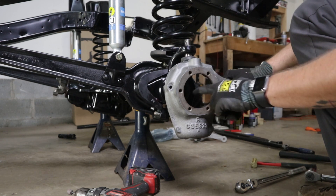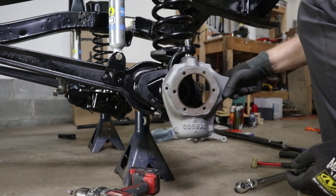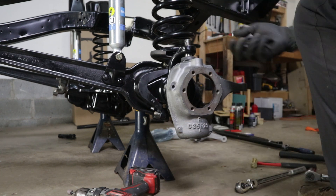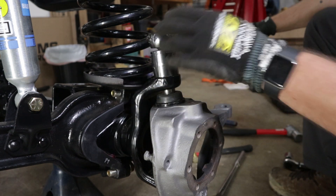We've got 90 foot-pounds down on our bottom nut, and 25 to 28 foot-pounds on our adjuster nut, which gives us 25 foot-pounds of pulling force to turn our knuckle on our ball joints. Now put the nut on top and tighten this down to 100 foot-pounds. That's it — hopefully that was helpful. It was always kind of a mystery to me on how to do this, so hopefully that helps. Thank you so much for watching, and if you haven't yet, make sure to check out the full restoration process on this 1974 Ford Bronco. We'll see you next time!